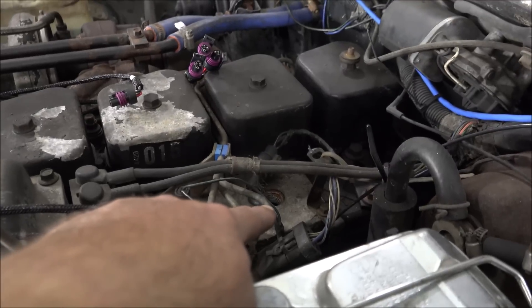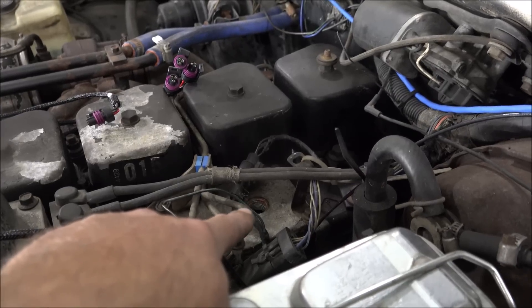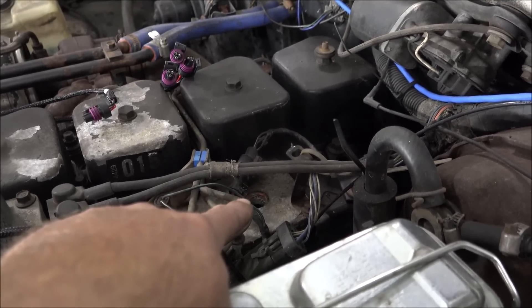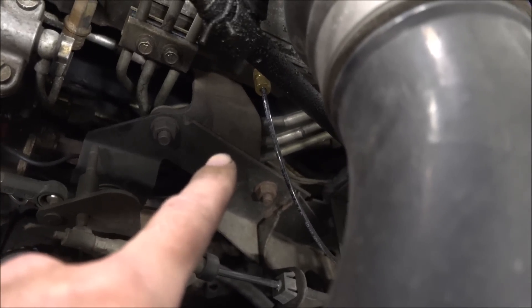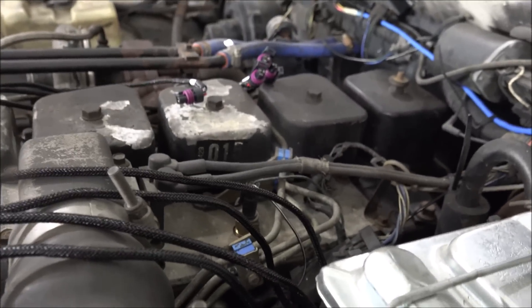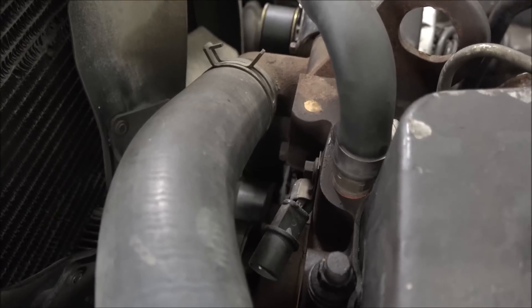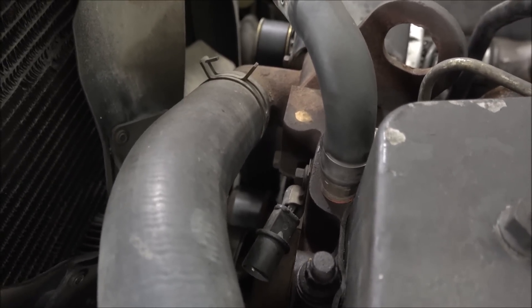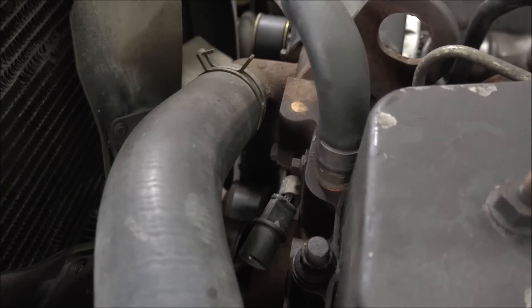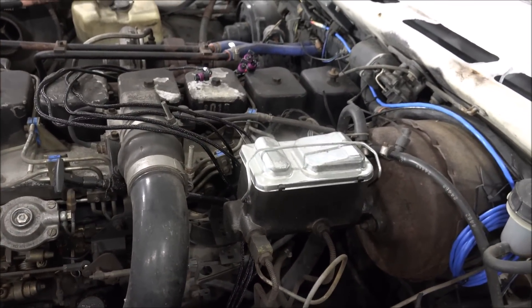I've already taken a sensor out there that I don't even use — it was for when this engine was in a different truck with a different harness on it. So I'll put my temperature sensor in there for the intake manifold and take my boost gauge sensor out there and read my boost right there. That'll be the manifold parameters. This truck does have the factory RPM sensor — it's not hooked up, but I think it works. I'm going to try and get a harness and adapt to use that one instead of putting the sensor on here. That'll make my life a lot easier.